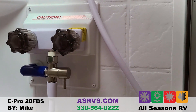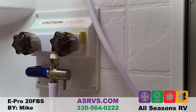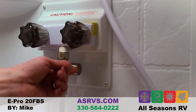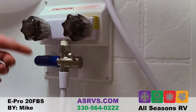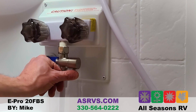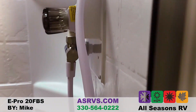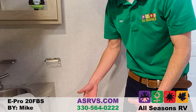In the bathroom there's a feature called a water miser. It shows blue normally, but when you're off the grid you have to be conscious of your gray tank filling up — any water runoff from the sink or shower fills it. With the water miser, it recycles that cold water rather than sending it to the gray tank. Once the water gets warm and the indicator turns from blue to white, you turn it on and the warm water then flows — saving all that cold water from filling your gray tank.